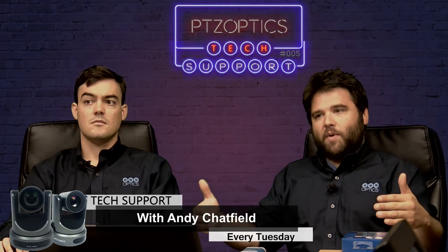Do users still need to plug in the camera directly to the computer before running it through the extension? I always recommend it, yes. It's recommended that the very first time you plug it into a dedicated PC, you plug it in and just make sure your camera is operating and running perfectly with no extension in place — nothing else to gum up the works. We have a two-week return policy, so you want to test your camera in that timeframe. Also, letting the drivers load for the camera first, not through an extension cable, is going to help the process along, because the extension cable has to load its own drivers too. If those two happen at the same time, they can cause conflicts that make neither device work. So always plug in your camera first, let it load the drivers, test it, make sure it's working — then run it through the extension, make sure that's working, and then install your system.